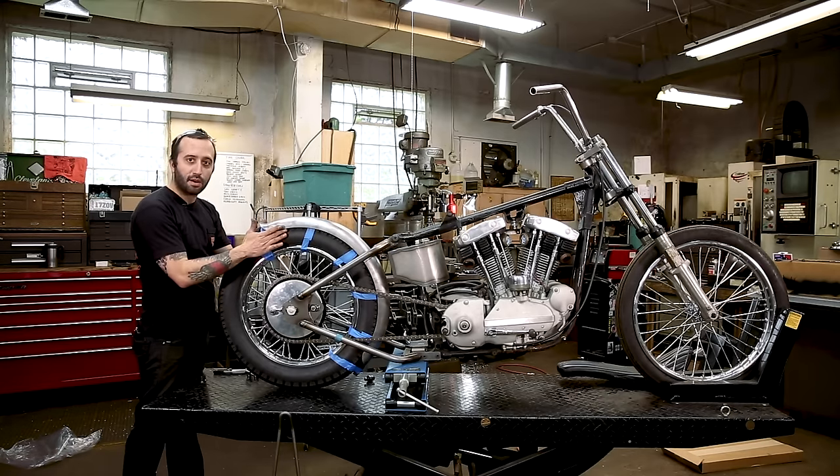Silicon bronze works really nice over any kind of zinced material like this washer, because since I'm not actually melting the material, it doesn't react with the zinc. If you weld on a zinc bolt or washer or nut or anything like that, you've seen that it changes the color. The thing likes to spit back at you and cause a lot of porosity, and you're grinding your tungsten a lot. Well, you won't have that if you use the silicon bronze.